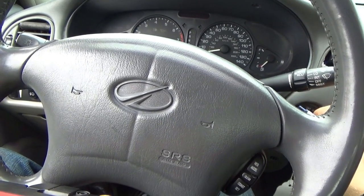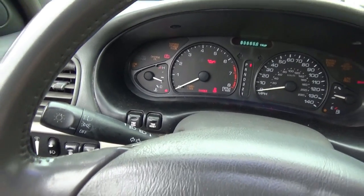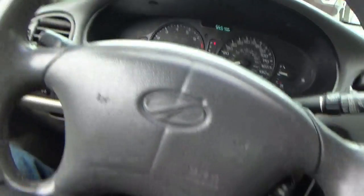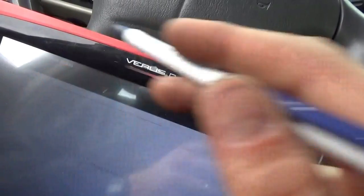Shut it off. Anti-lock brake and brake light do work. Okay, ABS display codes one more time — C0455 in history, no current codes present. Well, if the ABS light stays off and it drives normally and the ABS works, then they can keep this module and those three steering wheel position sensor wires just hanging out are kind of useless. Thanks a lot for watching, see you next time.